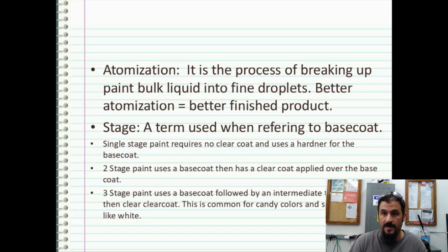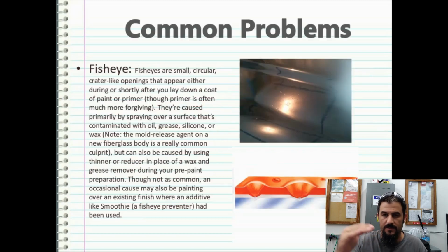It's because the aluminum pigments actually reflect sunlight and protect the base coat underneath. So they actually stand up to sunlight much better than, for example, yellow, which fades so fast. Red, solid colors, they're going to fade really quick. And I think I have these listed in kind of order of importance and what you're going to see.